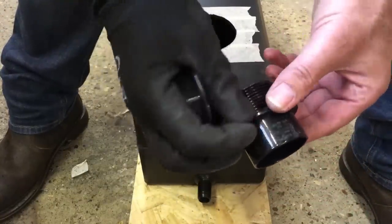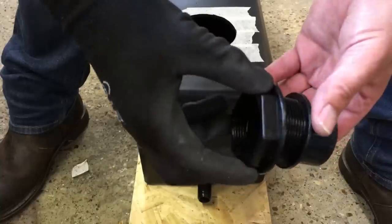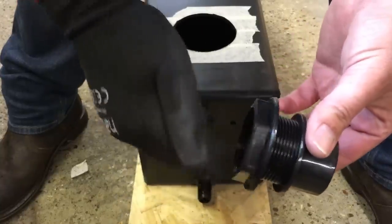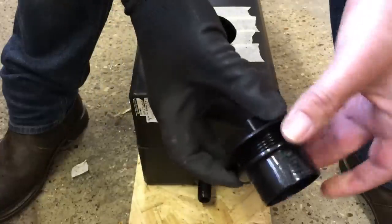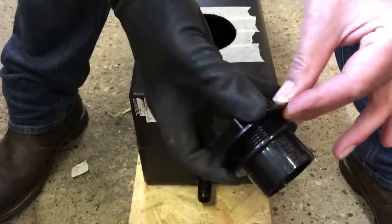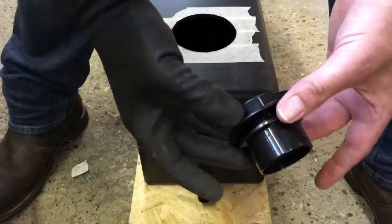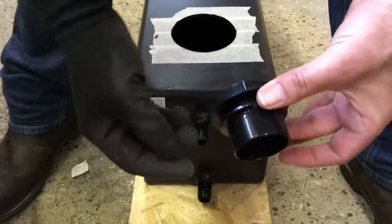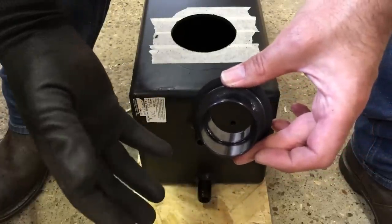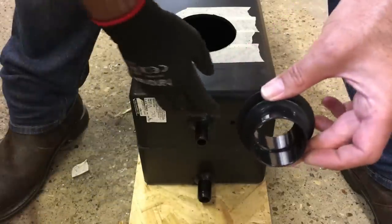What I've got is a tank connector - it's a two-part piece, threaded with a little flange on there. This is inch and a half solvent weld, and then this back nut goes on the inside of the tank, does up and sandwiches the wall of the tank. We'll put a little bead of silicone around there, nip that up, and once the silicone's gone off that'll be nice and secure and watertight. That'll give us an inch and a half inlet, so the shower and sink drainage will be a lot better than that tiny little inlet.